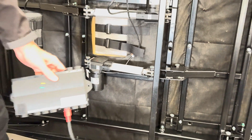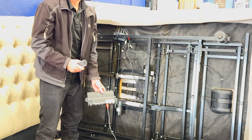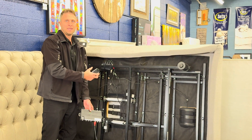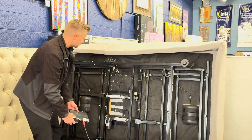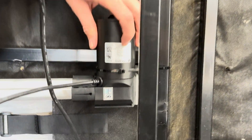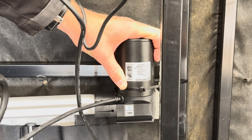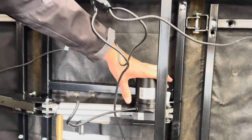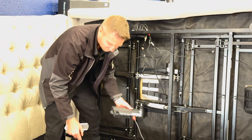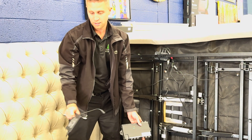The first thing you want to do is unplug the bed from power — just pull the power cord from the wall. On these units, in order to convert we're going to be working with DC current motors, which is important because if it's AC high voltage and something were cut and fell loose you could get electrocuted. So check any of your actuator motors for stickers — as long as you've got something in the 24 to 29 volt DC current range, your motors are new enough to be converted. The control box will also say DC current, and you'll have an AC/DC adapter that converts from AC 110/115 from your wall to 24–29 volt.